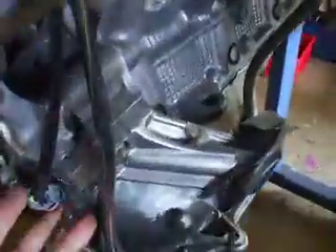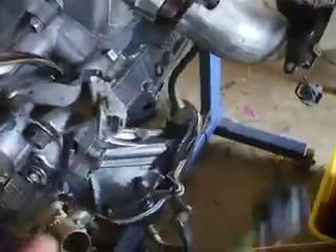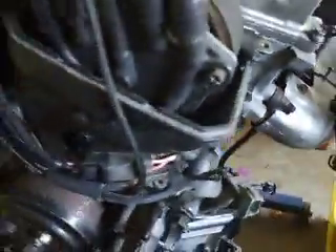I've been firing up the coils and tested them. We've got the wire going down to the crank sensor, which I like to run through the gap there through the back. Oil pressure plug is on the factory Lexus oil pressure sensor, and then I've got an extra plug — it's a few wires, there are two spares. If you want to put a normal aftermarket gauge, I've also run one that can go back to the computer so I can run the oil pressure through the ECU, do warnings off oil pressure levels, or monitor it with a dash, laptop, or while tuning.